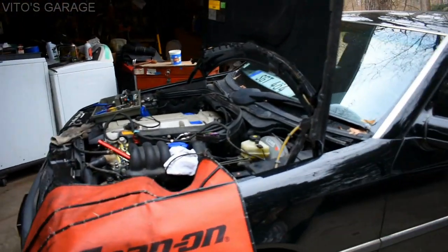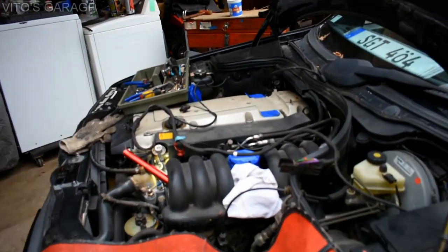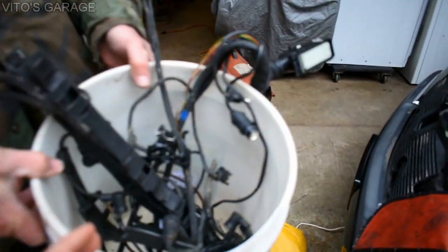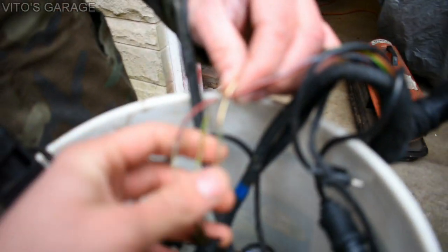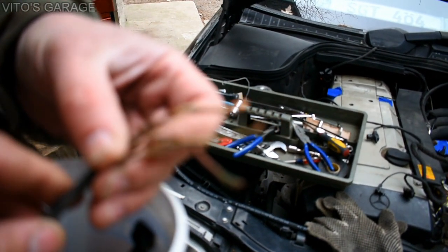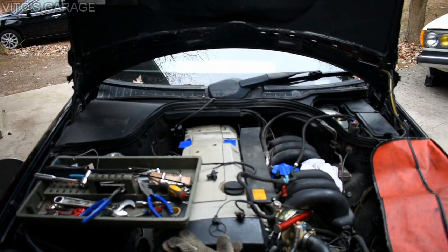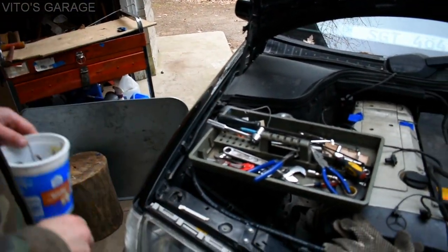So what Warren is working on — he actually got this car recently, but as you all know, this M104 engine has a biodegradable wiring harness. So we're going to show it to you in a little bit. This is the old one, and if you look at all these wires right here, they're actually pretty bad. Look at all this stuff — the whole insulation is gone. He replaced it right now, he's finishing replacing it. That's a typical piece of the wire — it's pretty crazy.